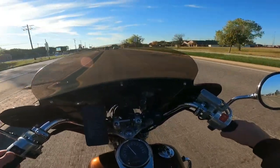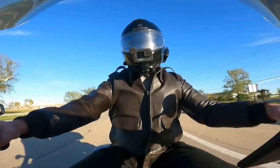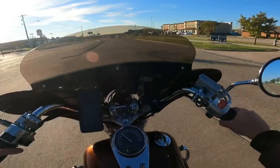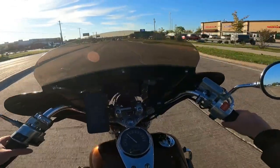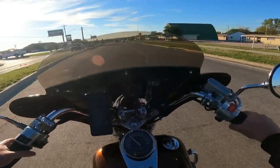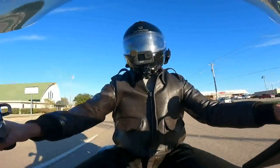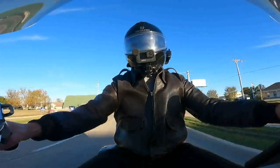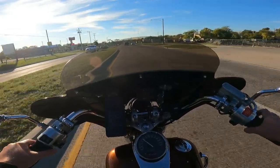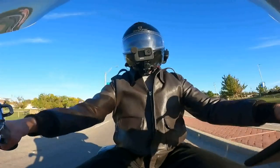And so with that being the case, I had to crack those things open. It's very easy, just a screwdriver, a few screws that had to be taken out, and then removing the electrical contacts, getting those things cleaned up, and it feels like new again. It had, like I said, about 38,000 miles worth of junk, road debris, all that kind of stuff up in those controllers. It really needed to be cleaned out.